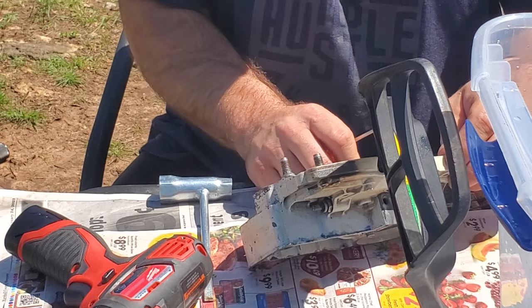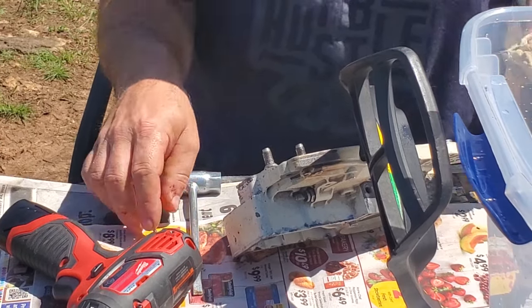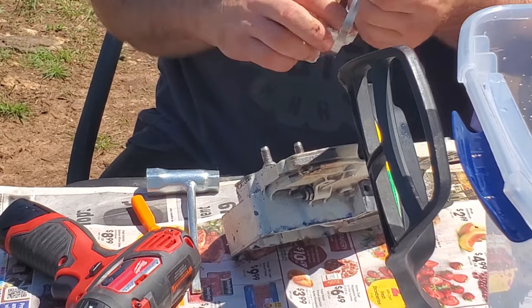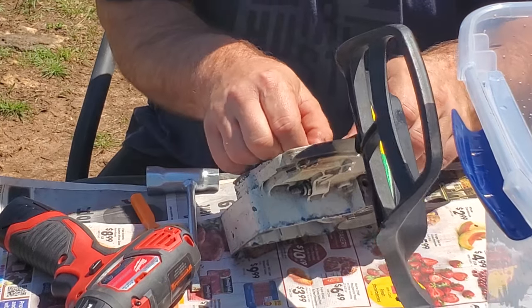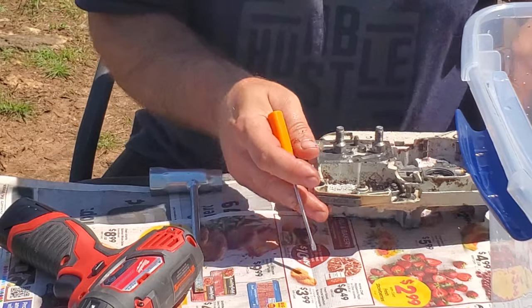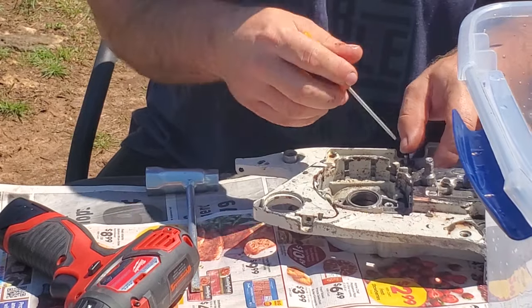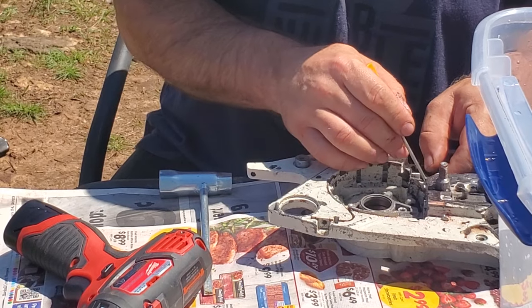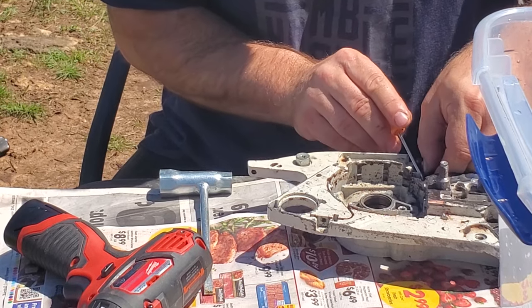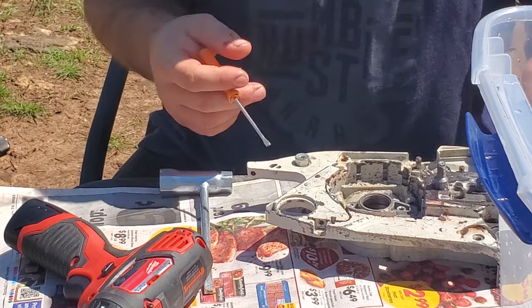He sent the saw and I ran into a lot of problems - it had a broken head bolt and only one other head bolt. When I started it, the saw would fire but die right away when you poured a shot. Normally you get two or three seconds of runtime, but I wasn't even getting a full second. I finally said screw it, I'm rebuilding it - that's what I do. I rebuilt the saw, got it running okay, but within a short time I noticed it was acting like it had an air leak.